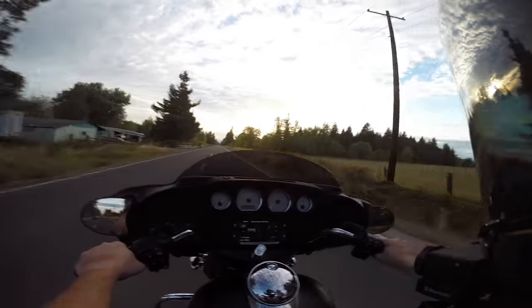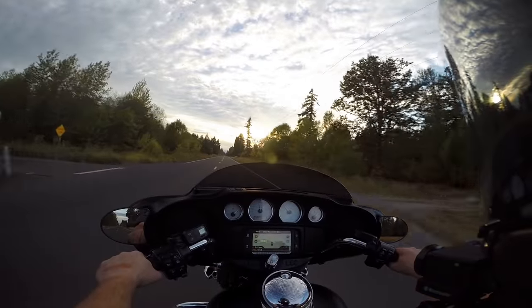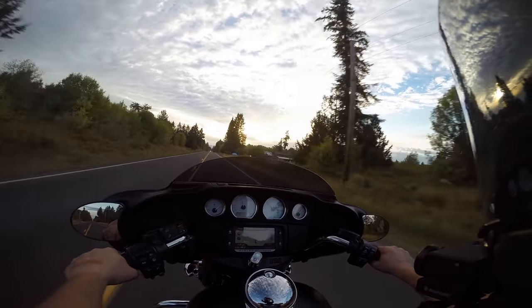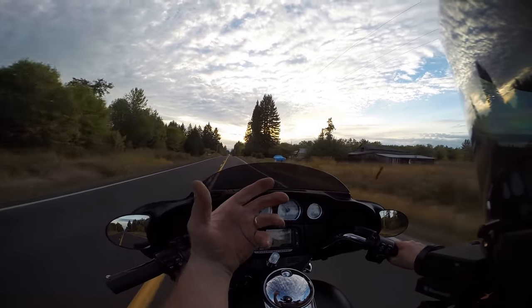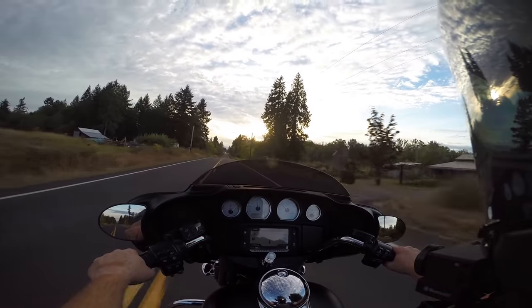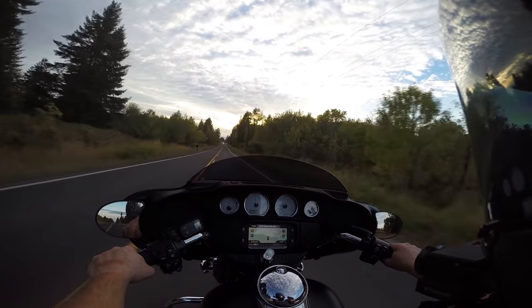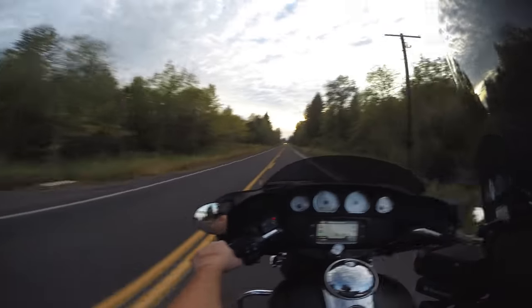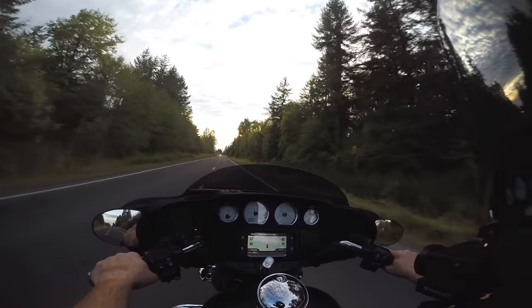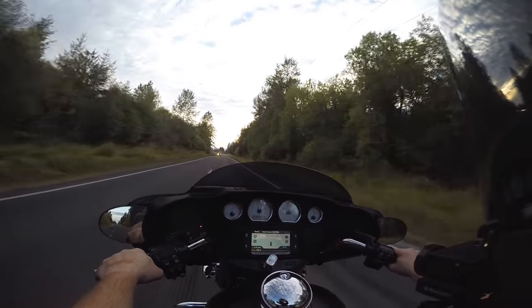So it was hard for me. I needed my wife there, somebody to measure for me. I couldn't turn around and see the tape with me sitting on it. So I just gave the pre-run the springs one turn of spring tension. There's lines or something in there, but I can't see them, so I just took a little Sharpie, put one little dot, and made one full turn.